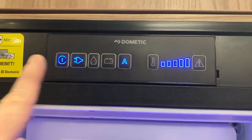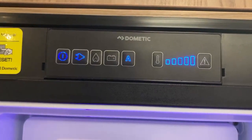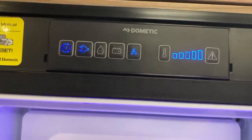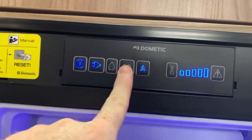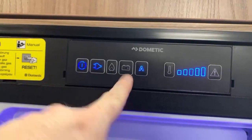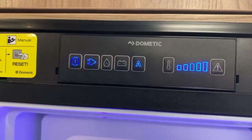As the name suggests, automatic mode means you don't have to manually choose the energy source when you change your motorhome's situation. You just leave it on automatic and it will manage things itself. For example, if mains electricity were disconnected right now, it would switch itself over to gas. The priority order is: 12 volt first — so if you're driving it prioritizes the engine source. If the engine isn't running, it prioritizes mains electricity. If it can't find that, it will use gas.